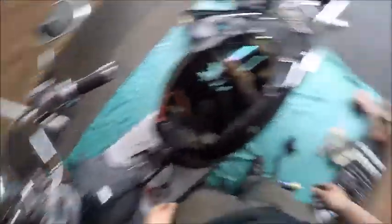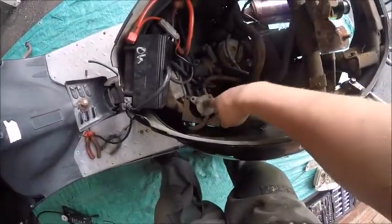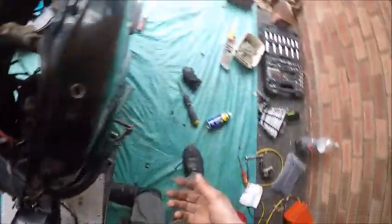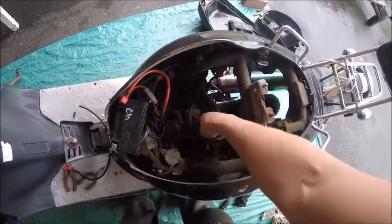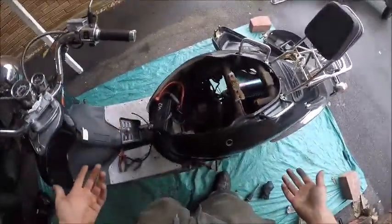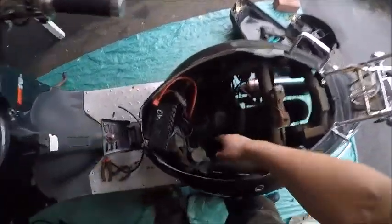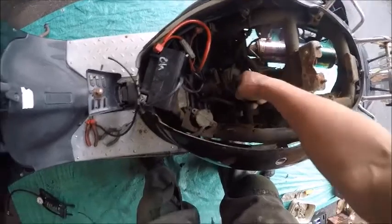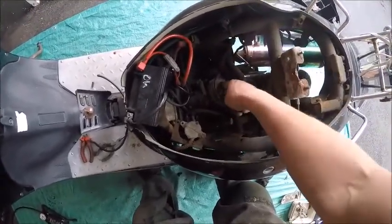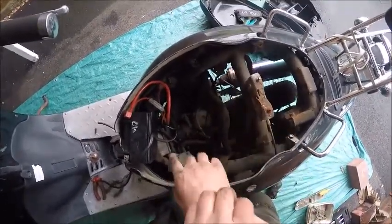I've decided to be a bit lazy to be honest. I put the battery on charge and found another battery I forgot I had which is sort of charged. I reckon the main issue was the vacuum lines that go here were all knackered - they all had holes in them so the vacuum pump wouldn't work and the carburetor won't get any fuel. I haven't drained the fuel so it's still got the horrible fuel in it, but it would be a pain to do because of where the drain is and I'd have to take the whole bike apart. So what I've done is hooked the vacuum line straight from the sucky bit directly to the fuel pump, bypassing the carb - you won't be able to rev it properly but it will hopefully pump fuel from the fuel tank to the carburetor. Even though it's horrible minging fuel, it might start. Let's give that a go.